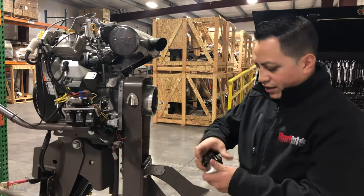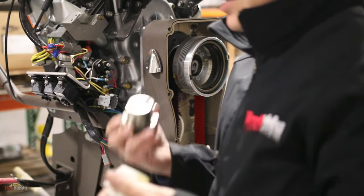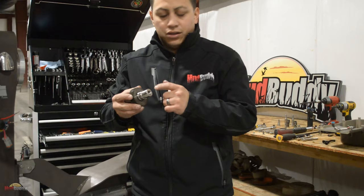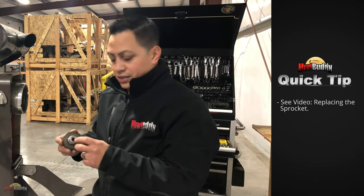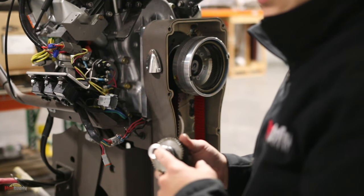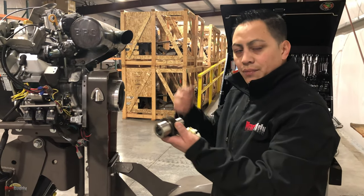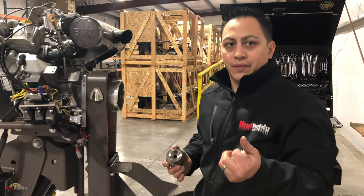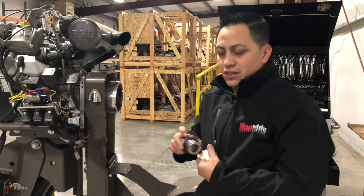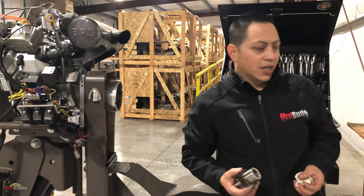We were lucky right here — I just pulled it out with my hand. Most of you know that never happens; this was just a lucky thing. If you remember the past episode, I explained how to take this out: this is a half-inch, 13-thread, so you can slide your slide hammer in, thread it in, and pull that thing out. I also showed you how to make a homemade one — really easy, just a half-inch bolt and a big socket.